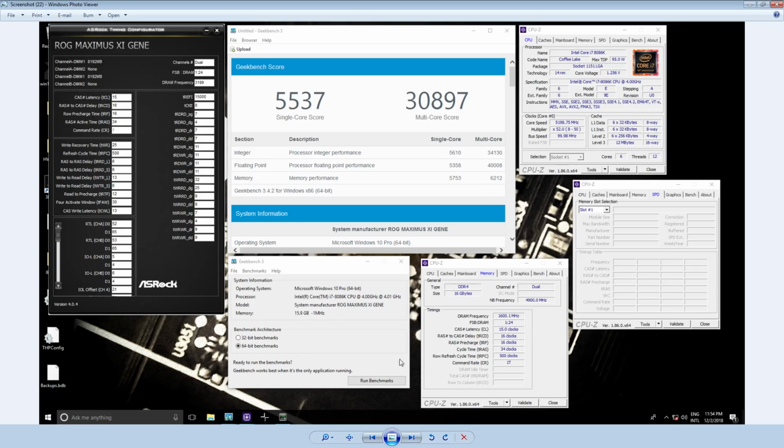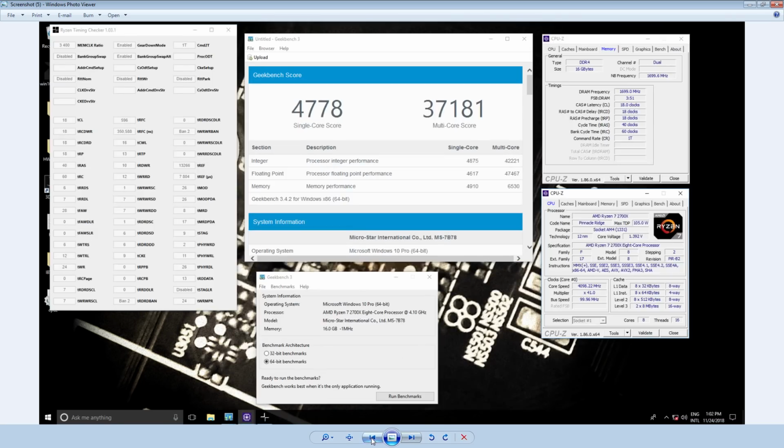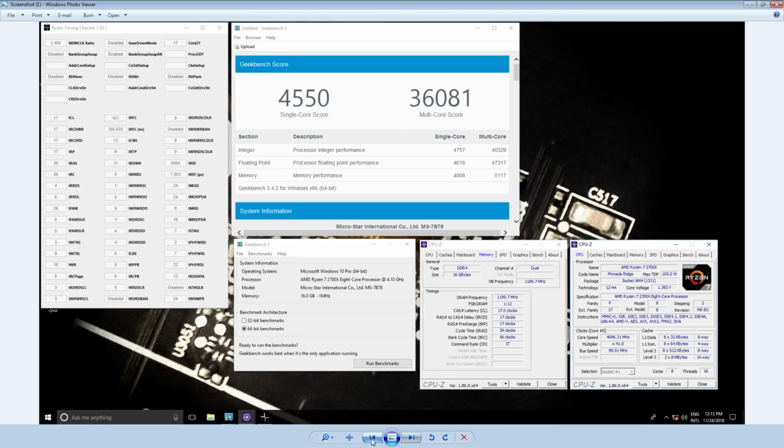But yeah, so you can see that for some reason the SPD doesn't pick up in CPU-Z. It does pick up on the side of the motherboard and stuff, but CPU-Z doesn't seem to like these sticks. So that's another piece of software that doesn't seem to like them, because Typhoon Burner also misidentifies the memory chips. So that's kind of interesting. But anyway, 2400 CL defaults to 17, 17, 17, 39, and we get about 5.1 thousand points in memory